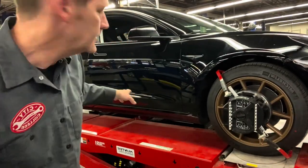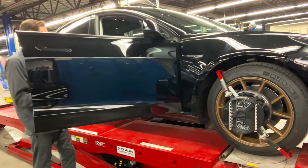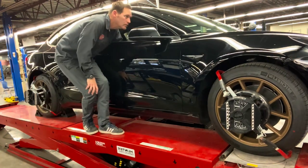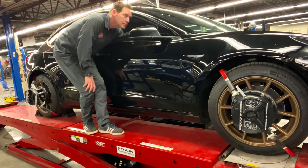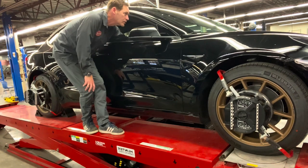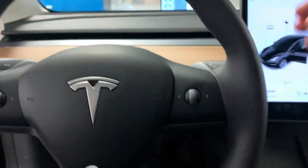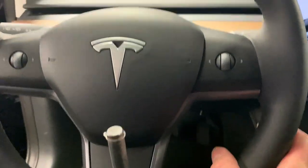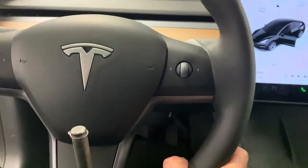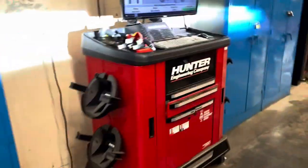At this point I don't need the car in neutral, so I'll open the door and it'll go right into park. Doing my caster sweep as normal — this is all normal alignment stuff. I'll put it in the steering wheel holder. Most cars have a straight piece right behind the steering wheel so you can line the two up, but in the Tesla there's not really a straight thing behind it, so I'm going to eyeball for straightness. They also specify a level you can hook on here. I'm going to order a few special things — the sandbags and the steering wheel level.